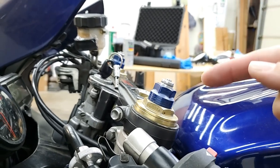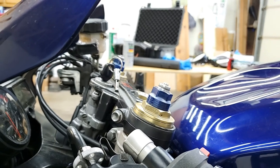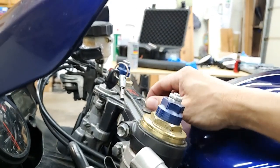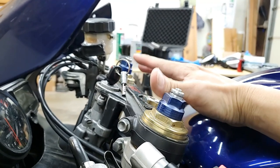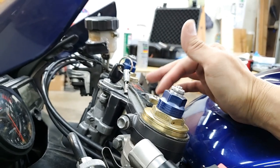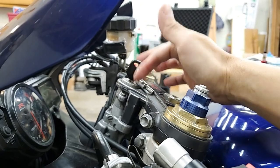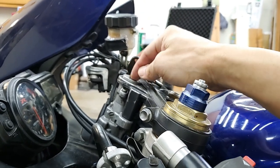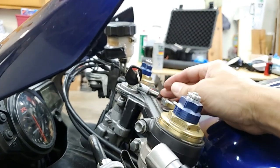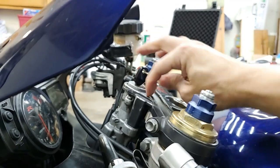Today we're gonna be looking at this cylinder lock right here. And I'm experiencing an issue after doing a fork job where I had loosened the center nut here so that I could align my forks. And I currently have a misalignment, but this is not always the cause of all the issues of this lock not working. Sometimes it's just a matter of the cylinder being jammed in here or from rust, and as you know, it's exposed to all the elements, wind, water, rain, dirt, and a lot of the times your issue could be the fact that this needs a little lubing.